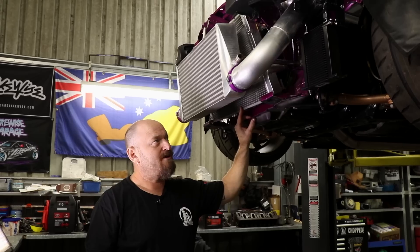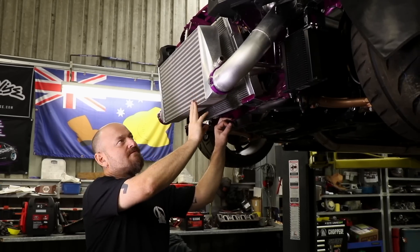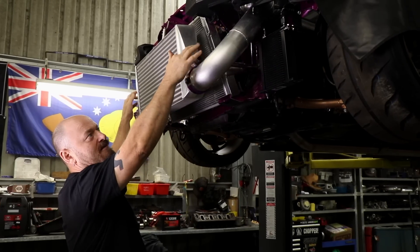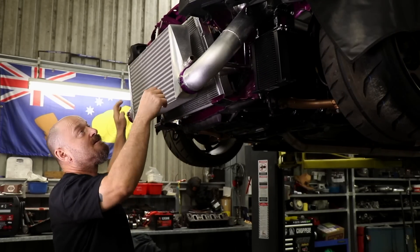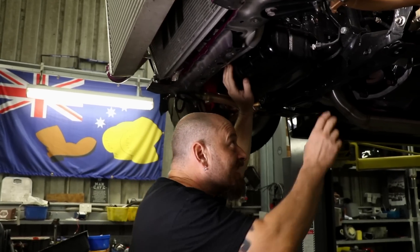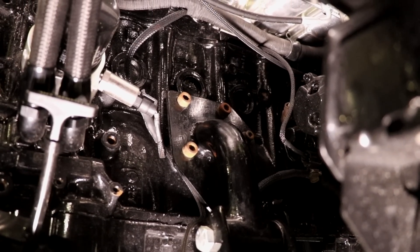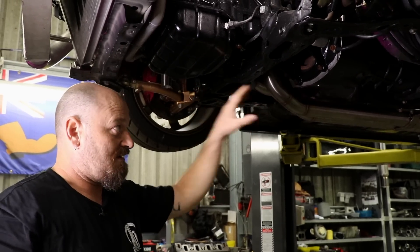To help the radiator along when it hits the track, there's also a Setrab oil cooler. There's a Hypertune intercooler — three-inch in and three-and-a-half-inch out to the throttle body, which is the size of the throttle body, so a little bit of customizing was needed there. Mounting-wise there was nothing to mount it off, so I've made some mount blocks; it's mounted off what were originally the crash bar mounts with fabricated stainless steel mounts, plus a top mount back to the radiator support. The engine mounting I've made uses shackle-type mounts with custom brackets, and the crossmember remains unmodified.